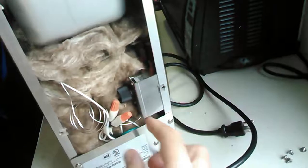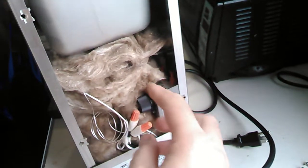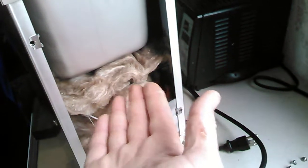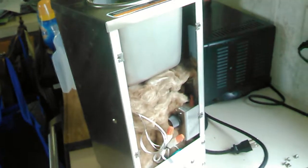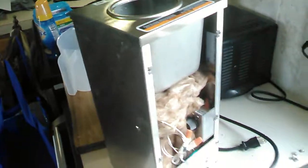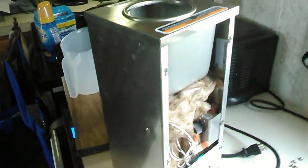And the design is pretty clever. So this is the top reservoir, and then on the bottom is the heater, and then the faucet is actually at the top of the heater. So even if you leave the faucet on and it drains the reservoir all the way, it doesn't drain the hot water element. So that way the element never boils dry. Like even if you run it till there's no more water left, the tank will still be full. So that's pretty safe that way. And then also, as soon as you add more cold water, you instantly can draw hot water again. So the heater element can keep the water hot even if the reservoir runs empty. So you get hot water right away.